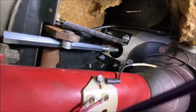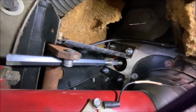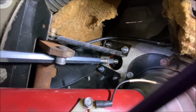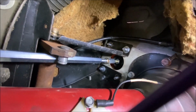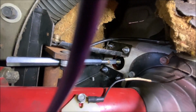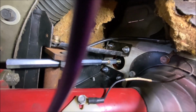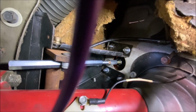On the other end, that's the best you can do because that tubular hex nut has to connect the booster to the rod. And I've got half of the tubular nut on the booster rod stud, and I've got half of it on this Mickey Mouse rod. So you can't do anything more with that. That's where it has to go. And then adjusting that length, I guess you really don't have to do that because you have this end where the eyelet is and you can adjust that. Okay, that makes sense.